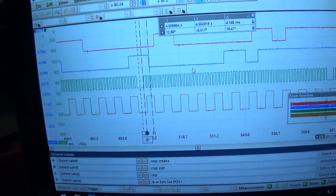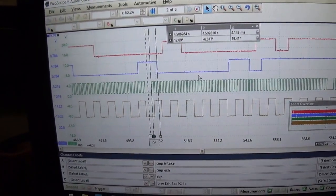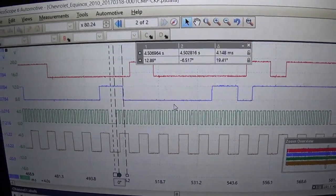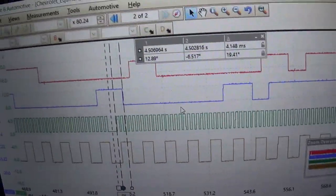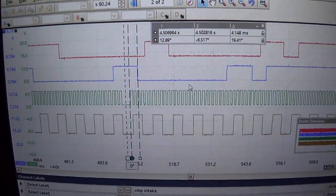But to have no intake manifold vacuum, to be running this poorly — we'll do a compression check. I'm sure we're going to get like half of spec, if that. But by our cam-crank correlation we're only off 20 degrees. We are retarded on the intake. The exhaust seems to be in the right place. So there's the intake and exhaust in the known-good, and there's our intake and exhaust. So that's where we're at — we'll finish this off with a regular compression test, old school style.